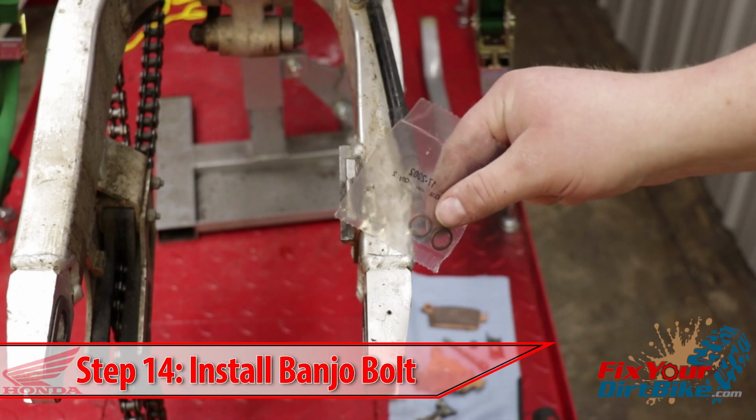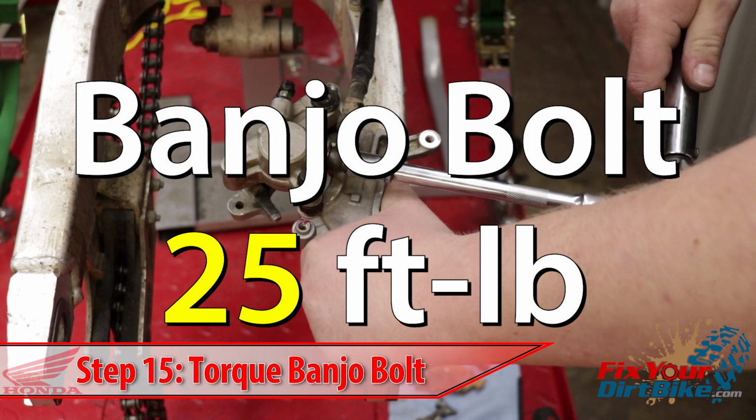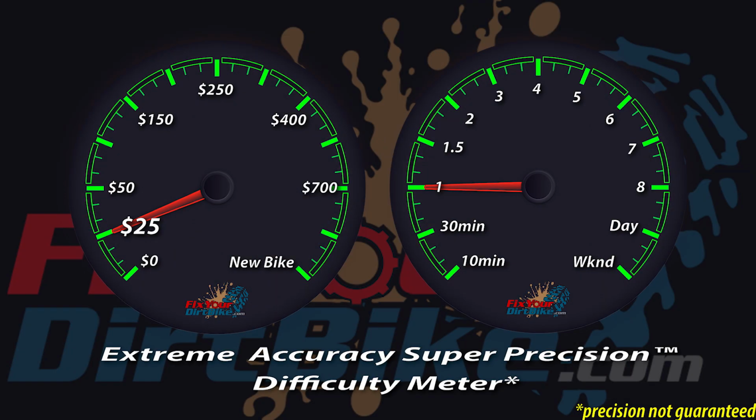Install the banjo bolt with new seal washers. Hold the bracket to the swing arm and torque the banjo bolt to 25 foot-pounds. Install the rear wheel and install the brake pads. Torque the brake pad pin to 13 foot-pounds. This rebuild should cost no more than $25 and take around an hour.